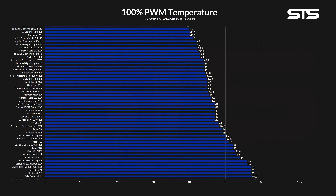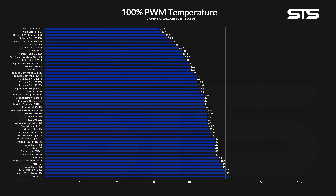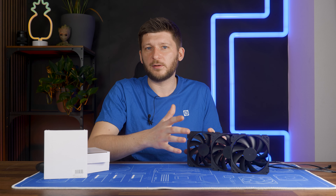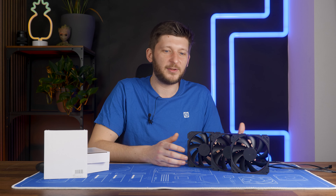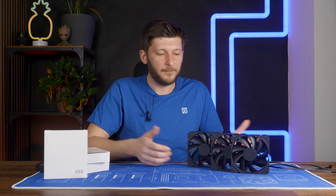While letting this Core 2500 spin at its max speed in our almost-heatsink benchmark, it managed to keep the CPU at 46 degrees C above ambient, placing it roughly in the center of our complete benchmark list. It's not bad, though at 2500 RPM it is one of the quickest fans we had, and every other fan at that speed is kind of a lot higher on the list. It actually has the lowest performance-to-RPM ratio I have ever seen, but it's still 5 degrees C ahead of the reference Arctic P12, so it's not that bad.